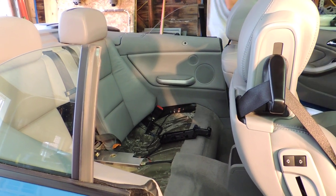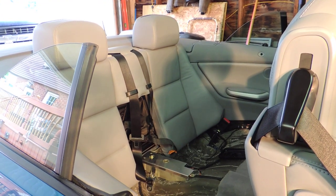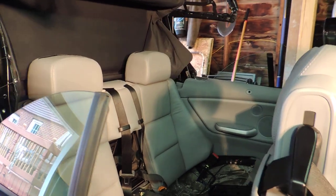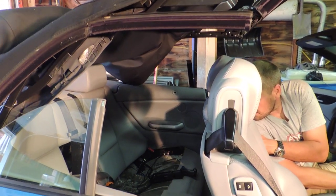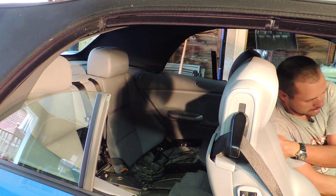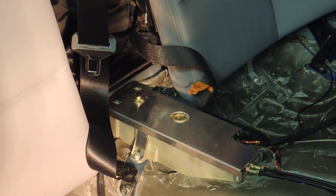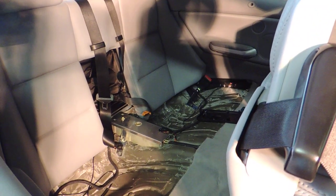Top is locked. Let's try this function again. This time we're going to go up. Let's try to pay attention to how the motor sounds. As you can see, it's turning nicely. Top goes up, at the end it should be engaging again. Fully up. So it looks like this motor operates when the top is just about closed and when it's just about fully in. That's when it's operating, and as you can see, no click, click, click. So I guess it fixed my problem.